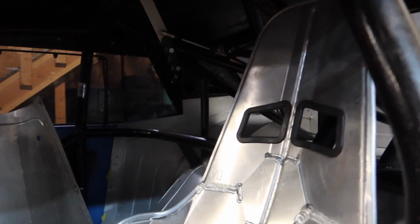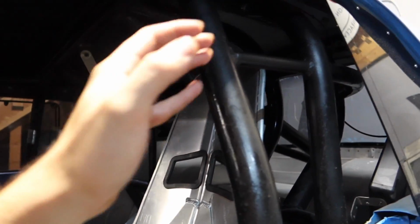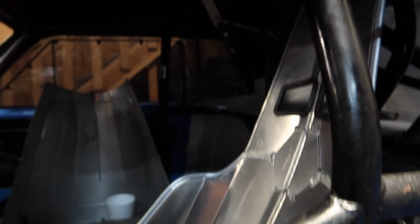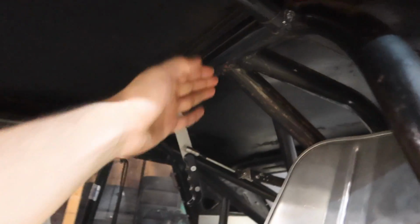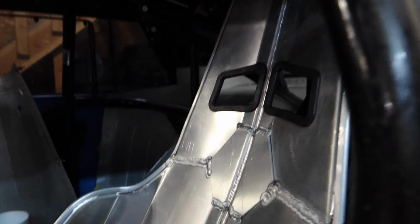No, the other half isn't really like any sort of driver enclosure part. They just kind of started putting bars behind it and then put this little one in here, which kind of ttricks you at first. You're like, oh, it's got a funny car cage. But when you look at it, a funny car cage would have the main hoop back here, and then you'd have stuff that comes out and goes down and connects to your harness bar, if that's what you want to call it.